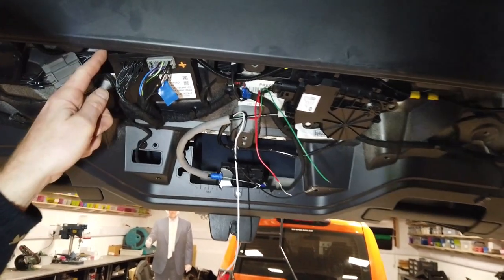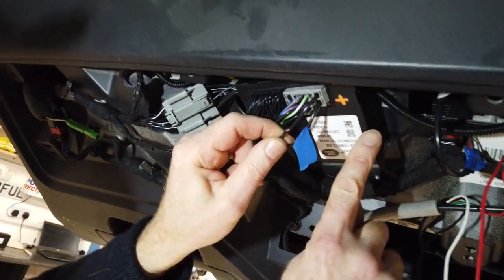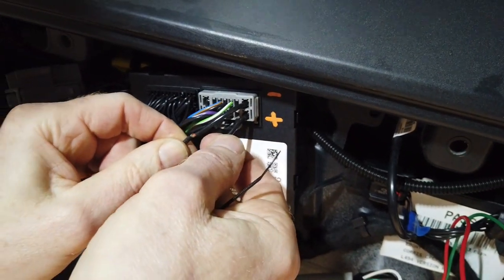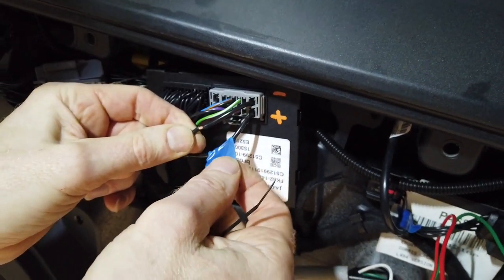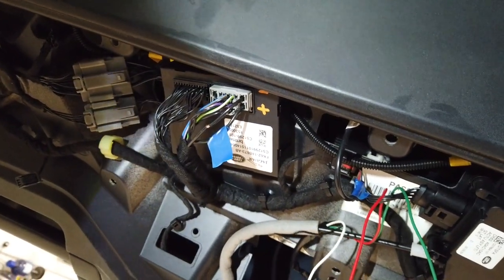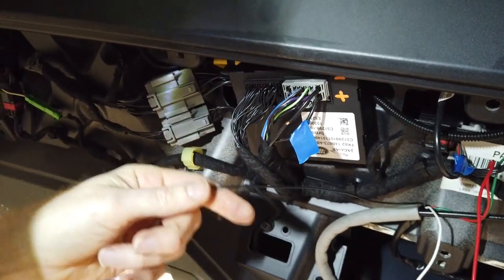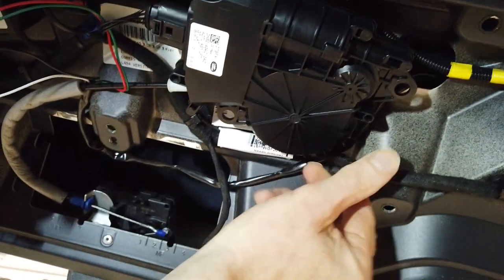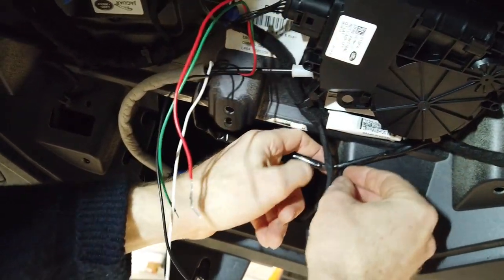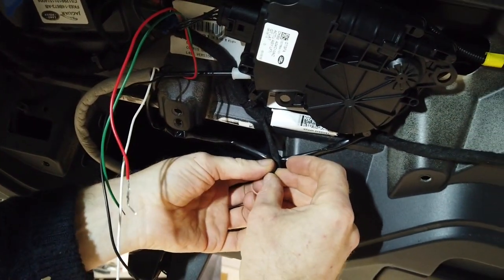You join us sat in the back of the Range Rover Sport. This is the main rear door module, and these two connections here are positive and negative. The top one as we look at it is negative and the bottom one is positive. I've connected on these before. Let's connect the negative on first — which is the black. We've routed the cable tidily around here using the other cables.